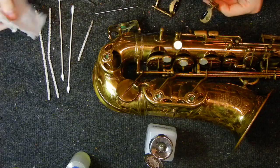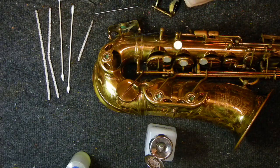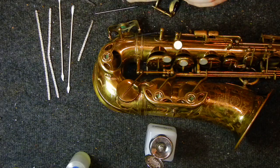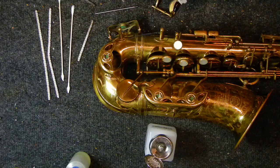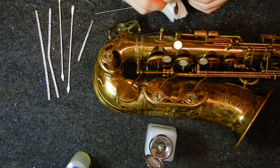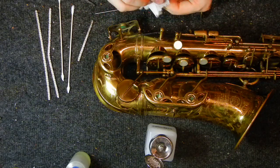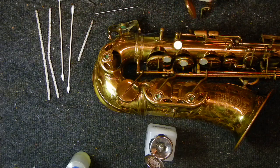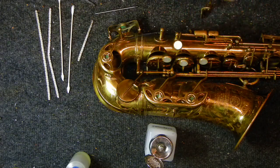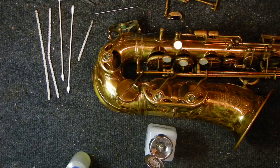Okay. Now the next thing I want to do, now that I've got the inside of my hinge tubes clean, I want to clean the faces of the hinge tube. So I take naphtha and I wipe these down. And you may see a bunch of stuff come off, you might not see a lot. It's very important that you do this because these are the gaps, right? This is where the oil could come in contact. So you want to make that really clean. Okay, and at the end, blow out the hinge tubes from any leftover stuff that came off your BJ Longs.